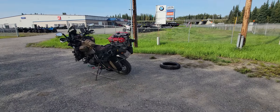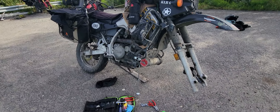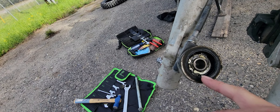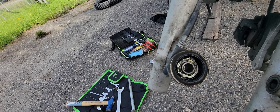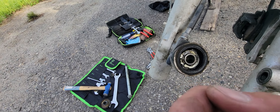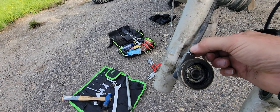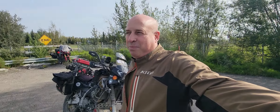I have a pivot point where I can get the rear wheel off. Before I close out this video — when your speedometer goes out, there's a tab there and a tab there that have to line up with the inside of the hub. As the wheel turns, those two tabs turn with it, registering the speed, trip meter, and odometer. I forgot to bring my extra grease to put the axle back in. When I was at my daughter's house in Corvallis it had just gotten loose, but haven't had an issue with that. My right knee keeps popping out — hopefully that's not going to be an issue.